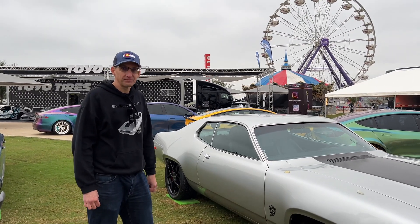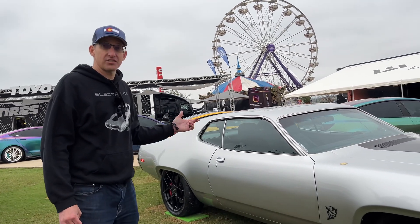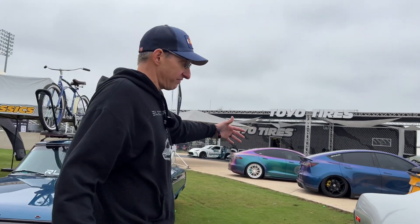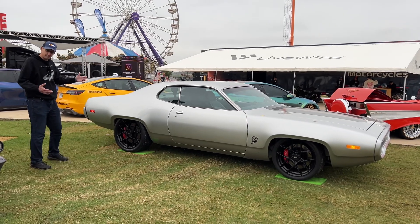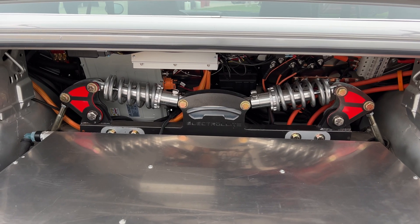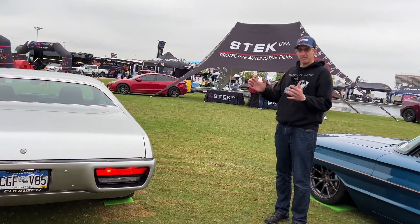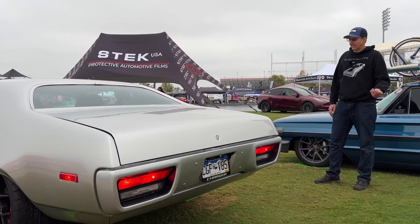How did you set up the drivetrain and why did you choose the components you chose? First of all, I chose the Tesla large sport motor — it was all about the horsepower, 636 horsepower. I wasn't sure about doing two motors since I was still learning, so I didn't want to bite off more than I could chew. In this car, it's a fat body, and if you look at a Model S, they're really wide cars. By measuring it out with the correct wheel offset, I knew the Tesla components would fit. The first challenge was mounting that whole subframe — I'm using Tesla suspension, from brakes to brakes, it's all Tesla underneath: aluminum subframe, aluminum independent suspension. It turned out easier than I hoped. It's all car-shaped parts that fit where the rear axle was, and that whole operation only took a couple of days.